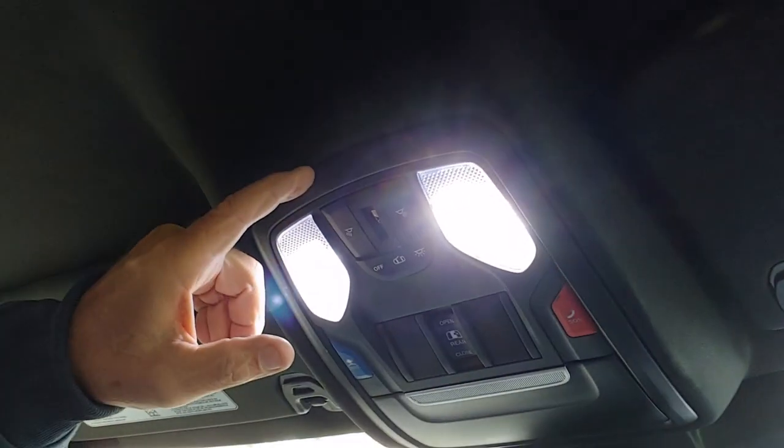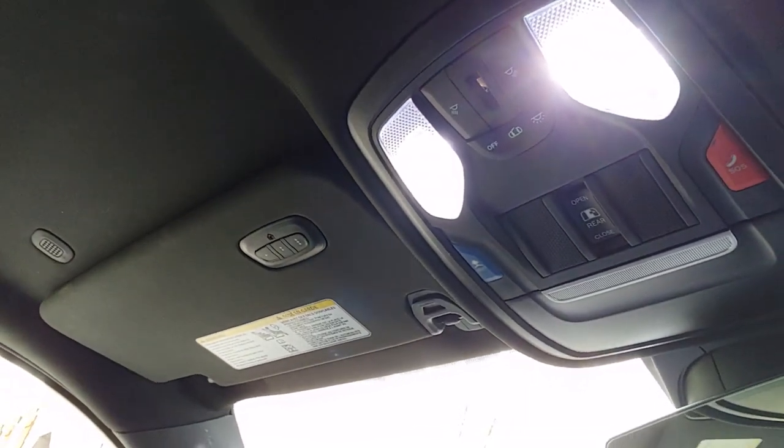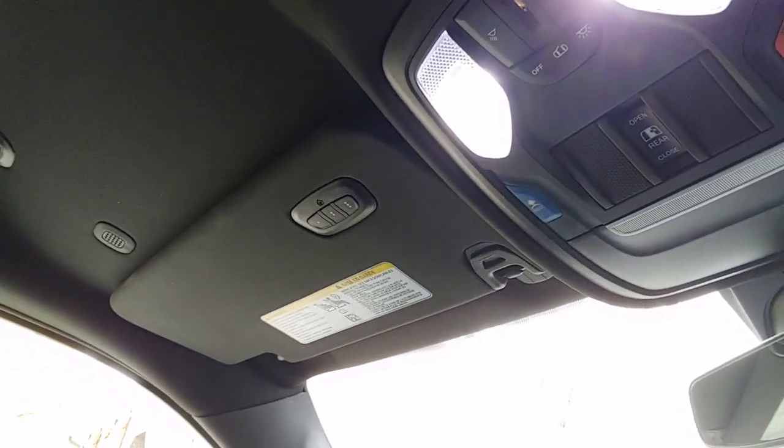And even in one of the videos that I saw, when the gentleman removed the front two 8mm screws and pushed the clips back, the back fell out. The front fell out. It fell into his hand. If that happened, that means that the front part here and here was loose in the slots, because the slots were worn out from taking this in and out, and because the clips were no longer spanning in there to hold it in, because the clips won't do it.